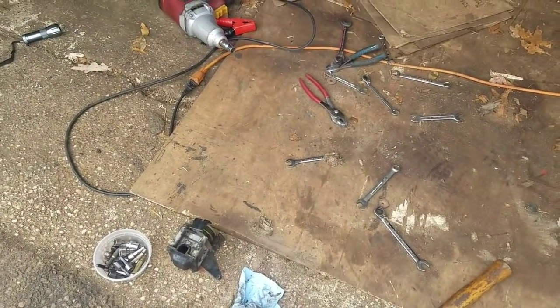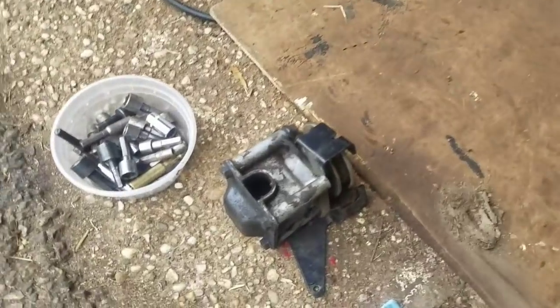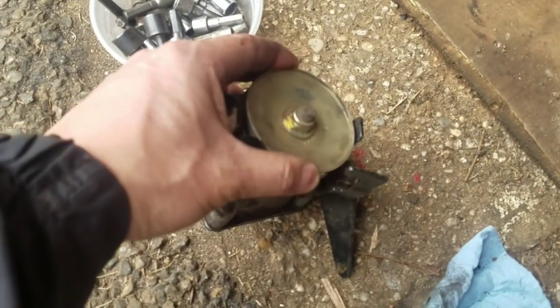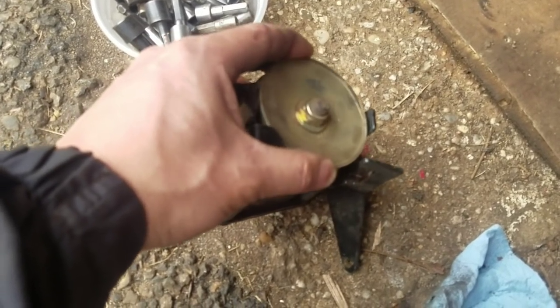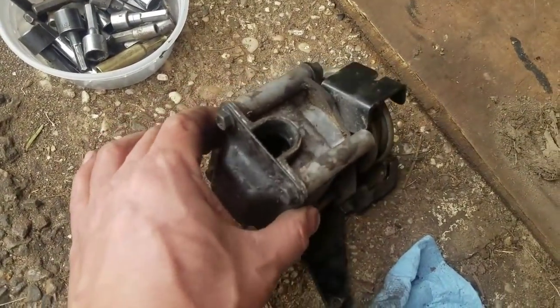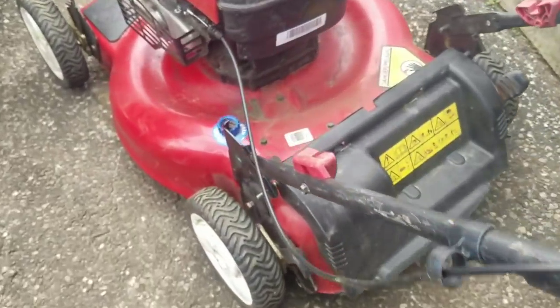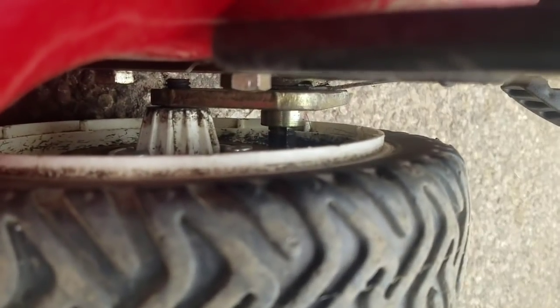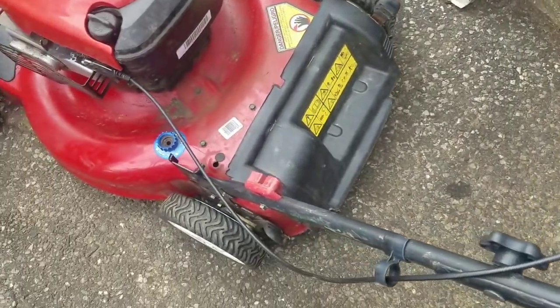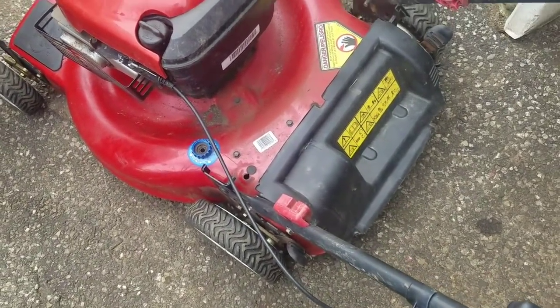It took some doing. I figured out that the bearing in here is busted, which causes it to move around loosely like this. See? Right? So you've got to attach a new bearing and then press it in with a special tool, which I don't have. In addition, the person who worked on this last knew that, and so they also took away the gears and the washers and the E-clip and all the stuff that comes with it. So this is now free-flowing and nice and loose. So I removed the cable that attaches to the drive-driven transmission. Keep that cable. And this is just loose, see?